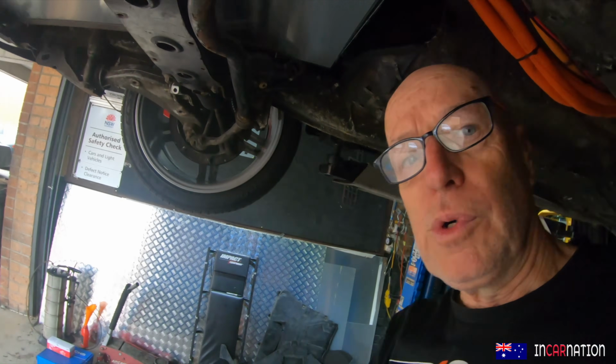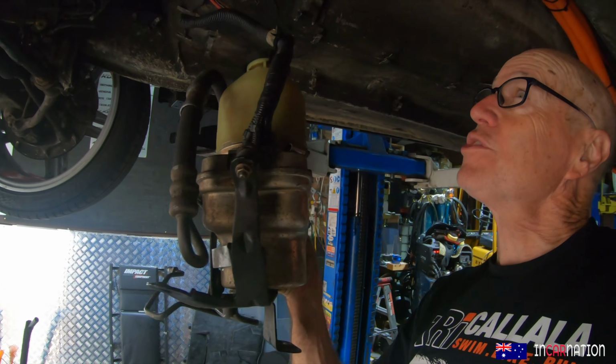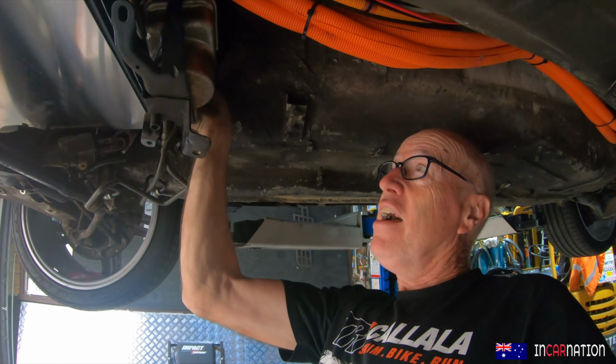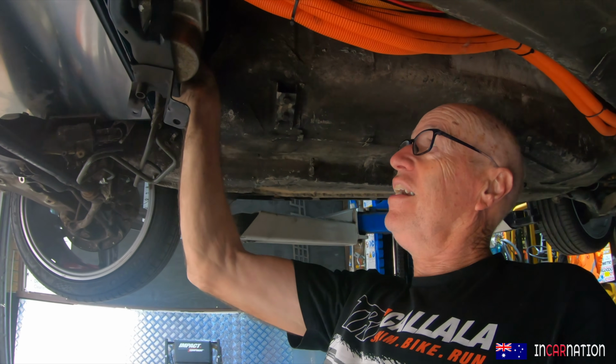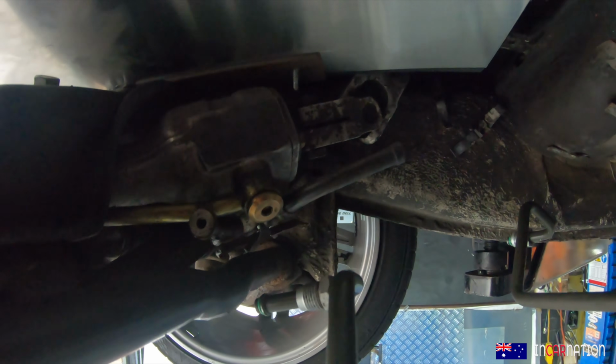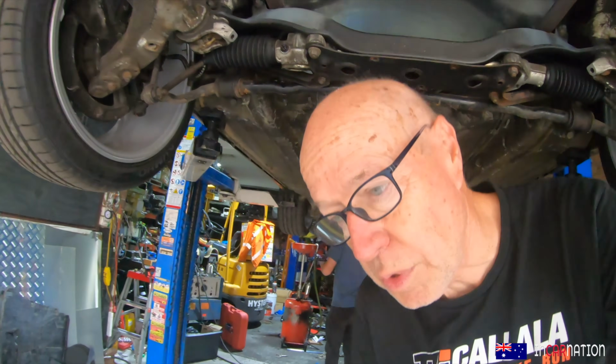And we're not using the Porsche's mechanical power steering pump. We're going to use this bugger out of an Astra, an electrically powered one. And I reckon it'll go up there. It'll be really hard to check the level, but it fits so nicely. And look at the high pressure and low pressure lines right next to the rack here, where they're going to be attached. So in that sense, it's perfect. Well, that should work pretty well.